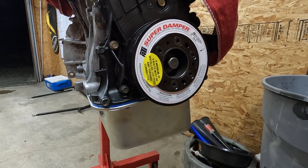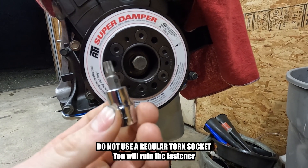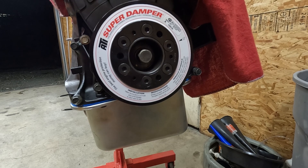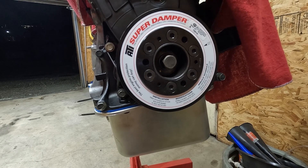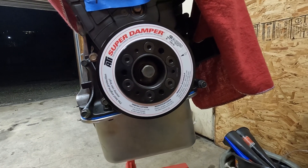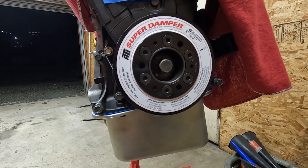The next step is to install the extra ring for the power steering belt. We're back with like day four of installing a crank pulley. I got all the stuff I need. I'm going to take out the six bolts that are on the hub, and I'm going to lock tight and torque them down. The six bolts are what is known as a Torx Plus T40, TP40, it says on this Matco socket. I didn't have one of these so I had to borrow one from a co-worker, but it fits right in there. I'm going to take them out one by one, lock tight them, and torque them. I'll let you guys know what the torque spec is once I read through the manual, and then I'm going to torque down these three bolts to hold down the accessory pulley. I left myself a note to torque the main bolt once I get a flywheel holder — I don't have one right now, but I'm going to need one to do the flywheel itself, so that'll be coming soon.